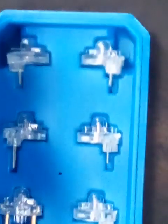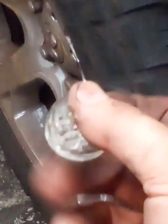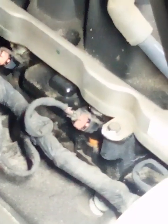And then most of the time people think they can just stick their Noid light on there. You know, unplug the circuit, stick your Noid light on there, and think that you're going to see the Noid light start flashing, but that's not so on these newer vehicles. You get a set like this, Noid lights. So you take your Noid light, unplug the injector, stick it in there, and it's not firing, so you think it's the computer, the driver's burnt out, but that's not true. On these newer vehicles, with the circuit unplugged, a lot of times the computer will shut the circuit off completely because it doesn't like what it sees.